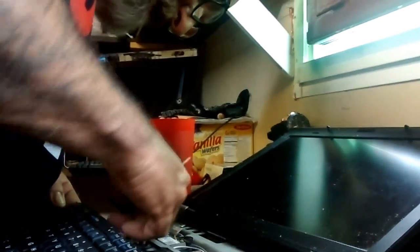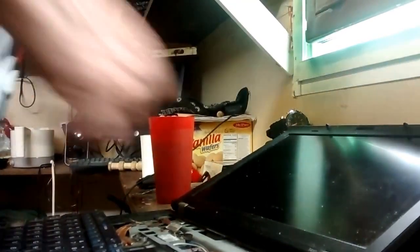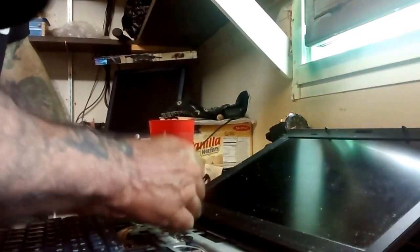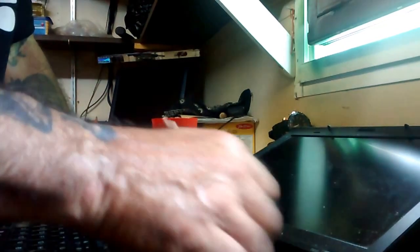Just going around slowly. Keep track of your keyboard so it doesn't fall off and rip the little ribbon cable — you'll be done with money right then. Have to be careful. Blow the fan out real easy. Make it spin a little bit. This is the first time it's been open since last time. Last time we upgraded it from 2GB of RAM to 4. It's DDR RAM.